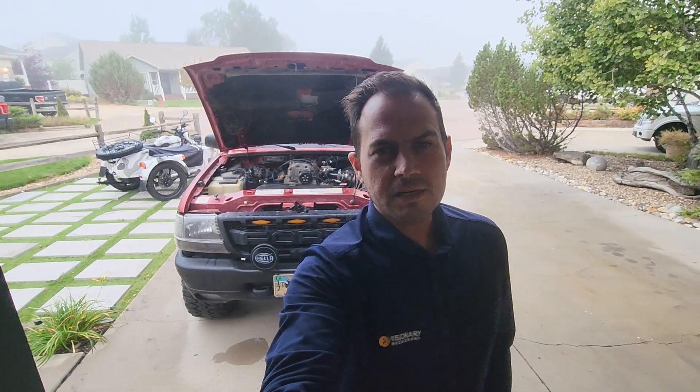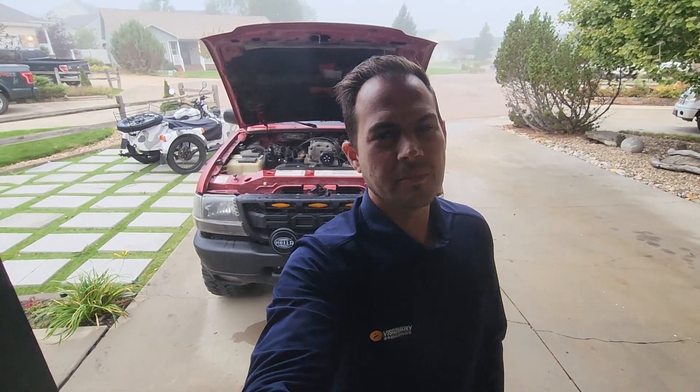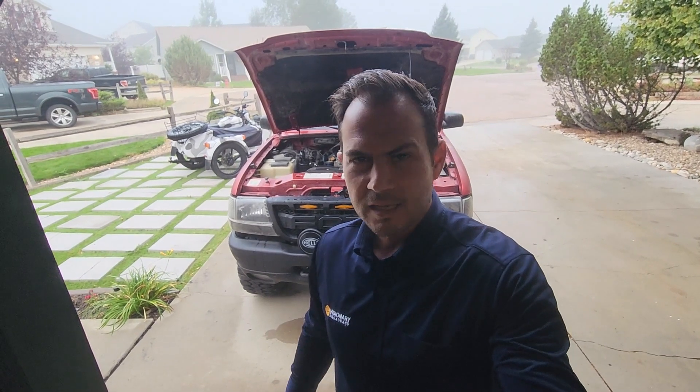Good morning — a quick update: the truck's running great. It runs like an engine that's had an extra accessory added to it, which it has in the blower, but I'm getting no boost. The vacuum all looks the same; it might even be a slight drag on power, which makes sense since it has to turn that supercharger pulley. I'm just happy it's running. I checked and there are no leaks anywhere — no vacuum leak going in, and no pressure getting lost out the back or the sides.